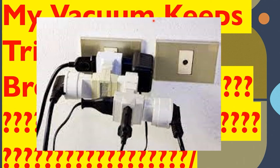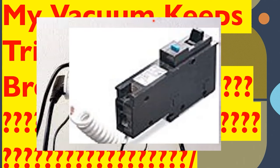Another really common cause is the cord. Looking at this cord, it's pretty frayed. Inside the cord cap, anywhere along the cord, all the way up to where it connects to the machine and even inside the machine, it could be shorting out — hot to neutral, hot to ground, or hot to the casing or inside metal components of the motor. You may simply need to replace the cord or have an appliance technician take a look.